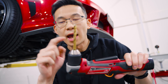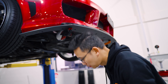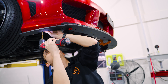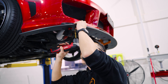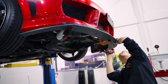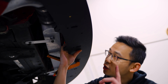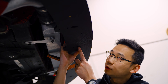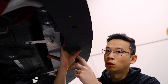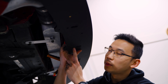To drill, I'm going to use an 8mm drill bit. That gives us plenty of wiggle room if we need to do any further adjustments. I've done the drilling, but I just want to mention that there are two drilling points you can use because this suits replica bars and also OEM bars. You can drill in any of those holes, and you can also use the middle hole if you need to, but you want to use the one that's further forward.